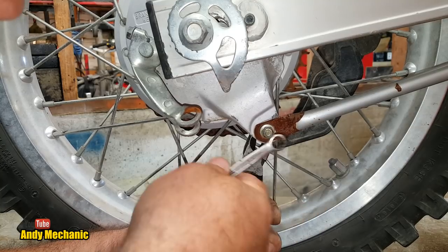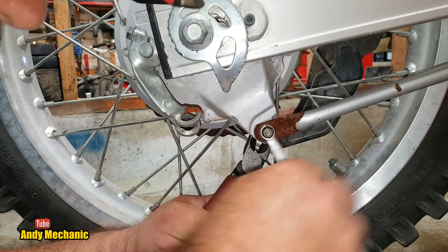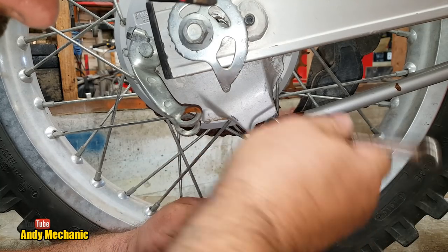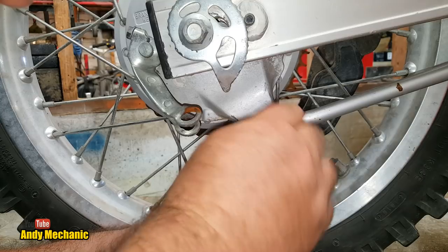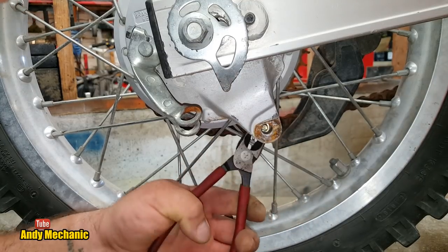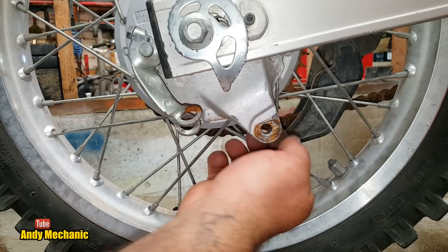This is completely, ladies and gentlemen, boys and girls, the wrong bolt for this application. It looks like something that's come from Mitre 10, or B&Q if you're in England. This is not an automotive bolt. Somebody has done a bodge. Lots of washers and bits and pieces. So it should be an M8 bolt that goes through there